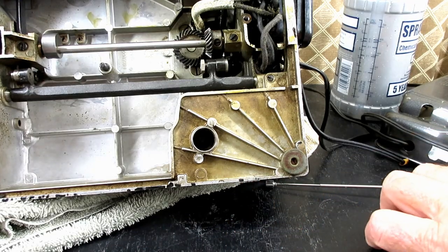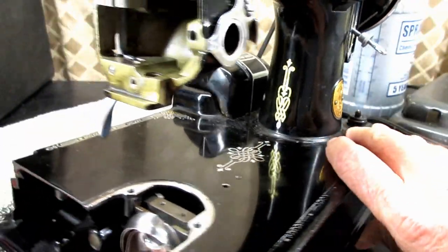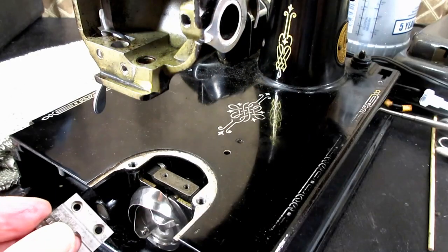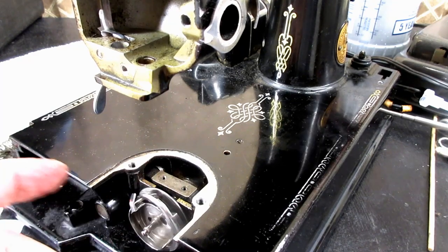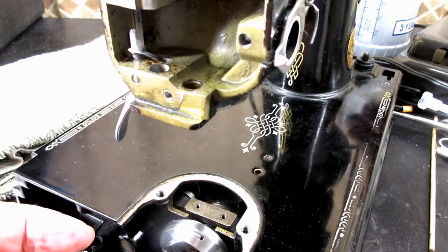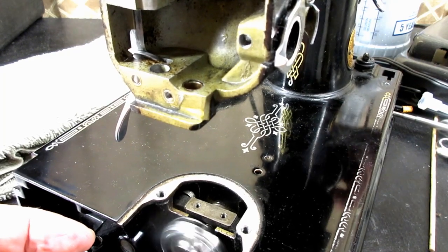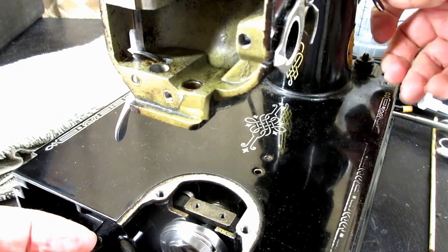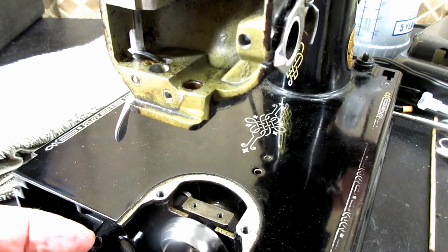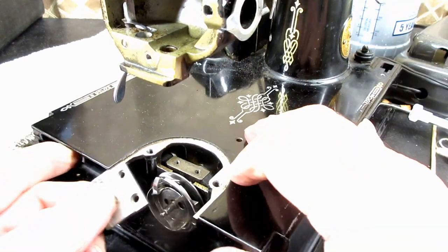I just want to mention one thing. Whenever you put a feed dog on any machine, or any of the ones that I've worked on, I have to assume newer machines are the same. But we'll see that feed bar, the end of the feed bar there going down and rotating. I'll make a longer stitch now so you can see that. Or the reverse, which will make it go from the back towards the front to pull the fabric to you when you reverse sew or back tack on the end of the seam.